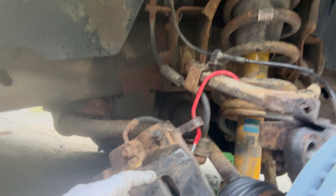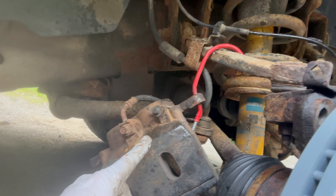Let me re-cap what I've done. You're going to take the caliper off. Then you take the brake pad, hold that thing off. Then we're going to pop these back in — new ones in. We're going to put this back on using an 18mm.